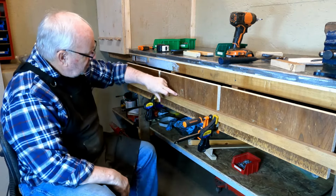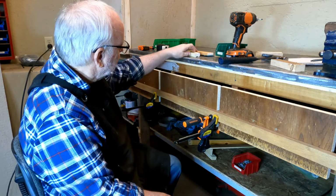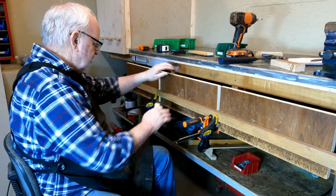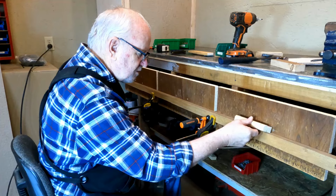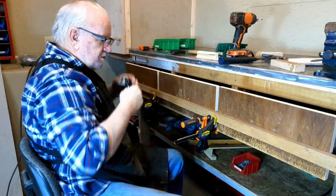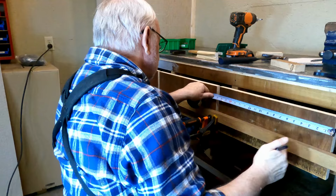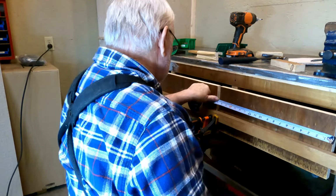So I made my mark down 3/8 of an inch from the center line because my drawer pulls are 3/4 of an inch wide. So then I clamped this straight edge on there, and attached it to all three drawers. So now this just goes right in here, but one thing I need to do is extend the center line here up higher. So that's 18 3/4, so that's 9 and let me see,